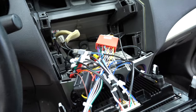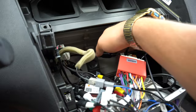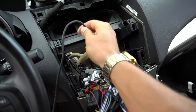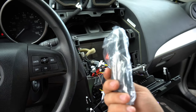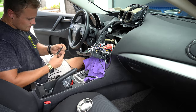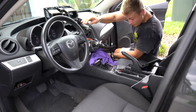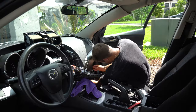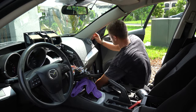Everything here is labeled and we have the old wire on the floor. I have taped that old micro USB wire, and the new USB-C wire is taped to it, fished through the dash until it came out on the passenger side floor. I removed the passenger under-trays and pulled the rest of the new wire through so I had extra play to route it all the way up to the top of the car. I could then route that wire up through the dash, behind the A-pillar, and behind the headliner trim until the end was right where I wanted it.